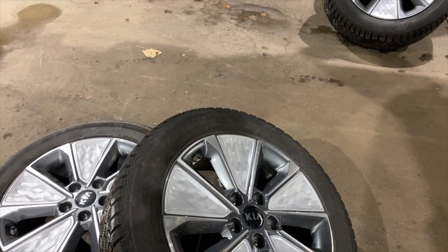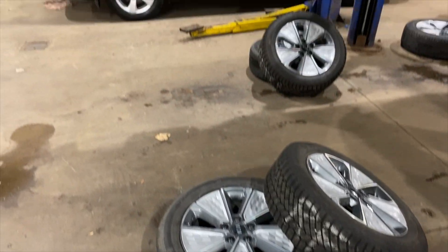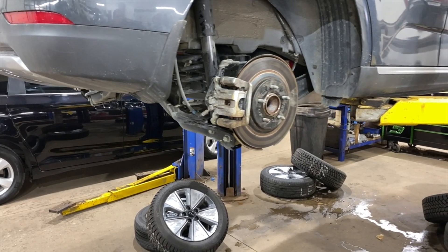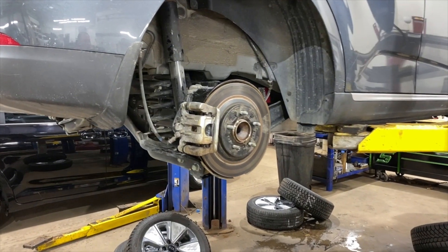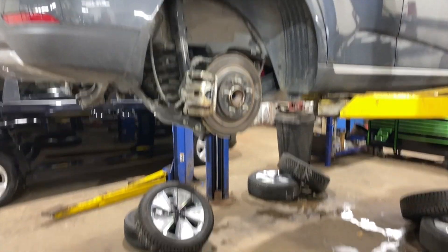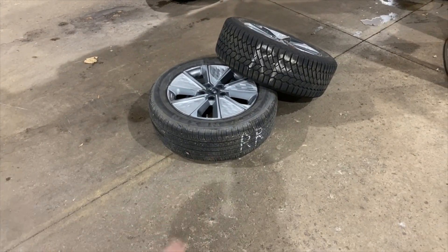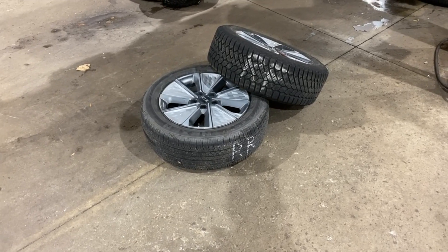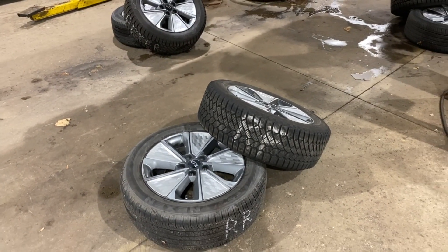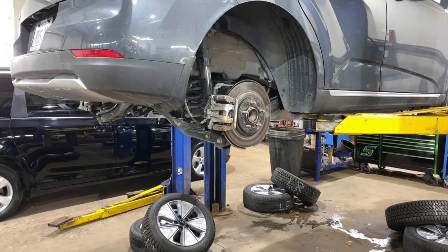A lot of people ask about range degradation. I'm using Gislaved tires and there is some range loss in winter, but the big benefit is grip. You've got vehicle stability control, an electric motor that reacts instantly with very little momentum, traction control, and ABS sensors on all four wheels — all of those keep this vehicle in line, but they require traction. The eco all-season tires are fine for three seasons, but when it gets slippery in winter you'll see a huge benefit from winter tires. I strongly recommend them despite the range loss.